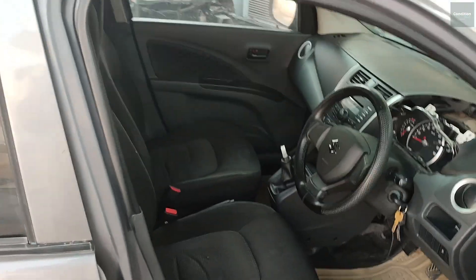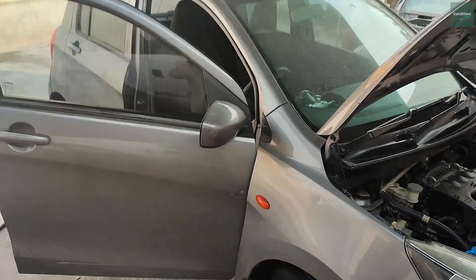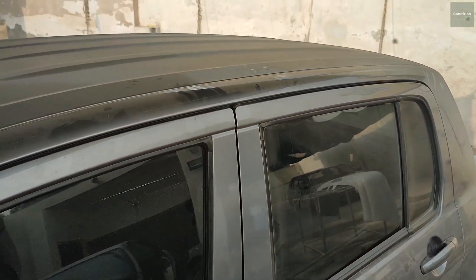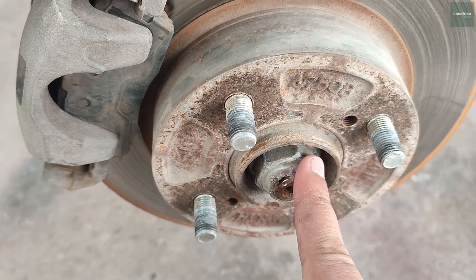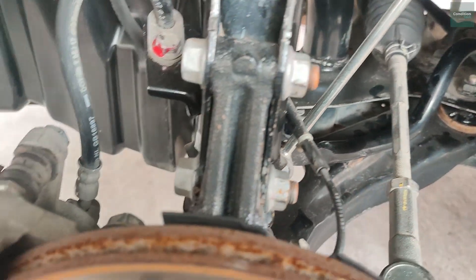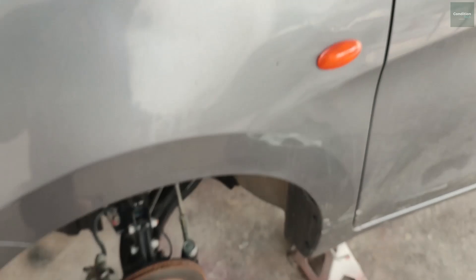So this is a summary of all the work done on the car. Now we will wash it from outside and then we will finish this car. This was not a very detailed project — it was a short visit project and we were looking to make this car better. The car now has new wheel bearings, new bushings, and proper torque on the nuts. We also noticed the Z-link — it was already worn and touching the ground, so that needs attention going forward.